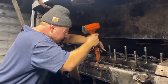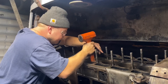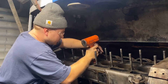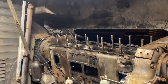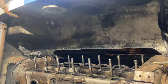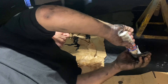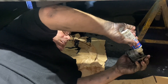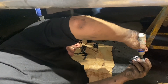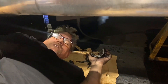You can hit harder than that. There you go. Almost there — are you there? I don't think so. It stopped. Okay, then it's there. Castle nuts? Yes please. I'm putting the bearing caps on — the number sides are going to the blower side — using some Lucas Oil assembly lube. That's pretty good stuff. And then these take castellated nuts that the cotter pin goes through.